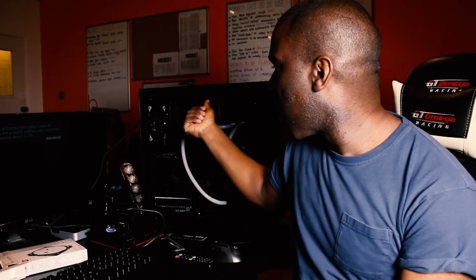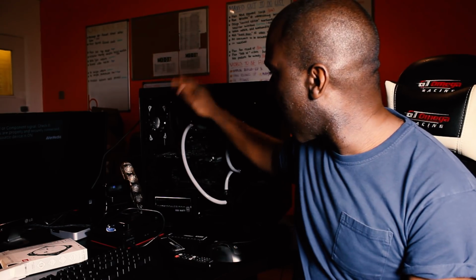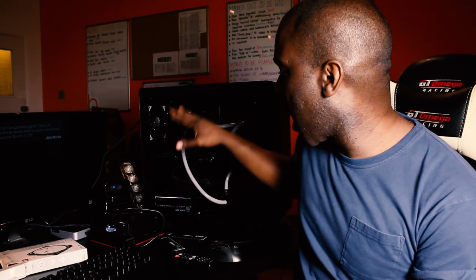Even at 4 gigahertz it was nice and quiet, but it wasn't very stable. And as soon as I put the Be Quiet fans in, instead of exhausting and dissipating heat, I had them blowing onto the VRMs and everything like that. It kept the system cool inside, and it stayed stable for over an hour at 4.5. I didn't actually go any further, and I overclocked the memory a little bit and got a stable overclock of the memory, done the timings.